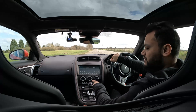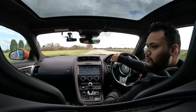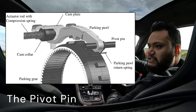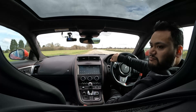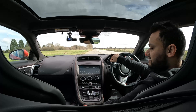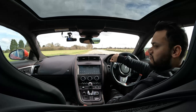So that was putting the transmission into park, and the result is nothing happens at all. In a mechanical selector, putting the car into park may trigger the parking brake, but since this car has an electronic button to put the car into park, nothing happens at all. There is a safety override for the system. So let's see the next step, which is pulling the electronic parking brake while on the move.